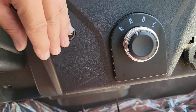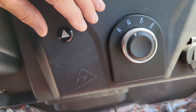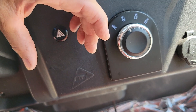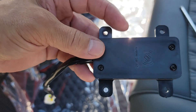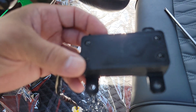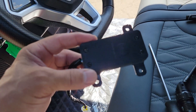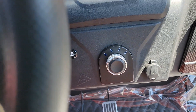If yours is intermittently turning on and off, it's very possible that the magnet system is defective — it's got little microchips in it and is very small. We opened this box up and it's clear something was faulty, because we swapped the module from another cart and now it turns on and off every time.